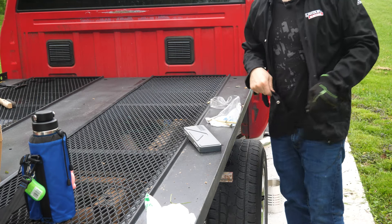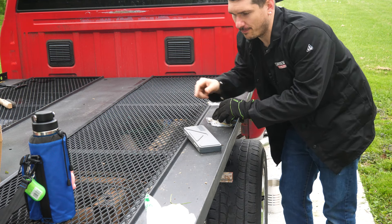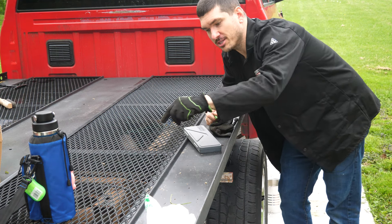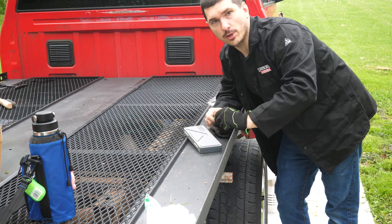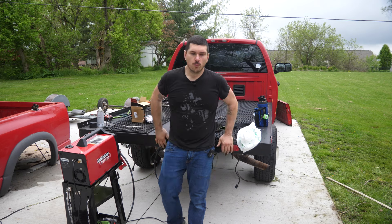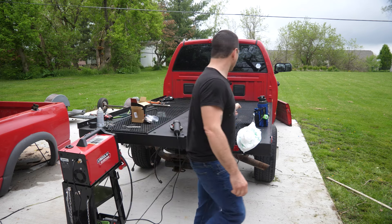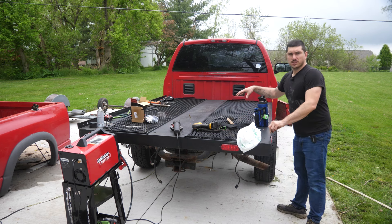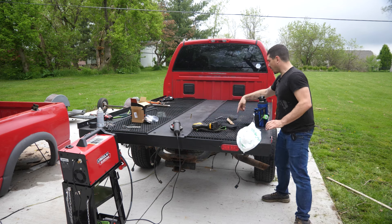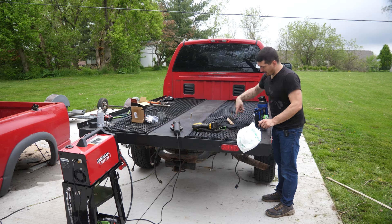There's not a chance I'm going to show you my welds, but suffice it to say they are technically connected and we can actually bolt it in now and line up the rear. I was going to tack it and then pull it off, but I was able to reach three out of the four sides so we're calling that good. Since this is fully custom and we're just kind of flying by the seat of our pants, we decided to do one grade-eight bolt right through the center of the trailer in the rear. We couldn't find a good place to mount it without messing with the spring perch and the rear suspension, so one bolt straight through, and then I tacked it in place through the rust just to hold onto it.